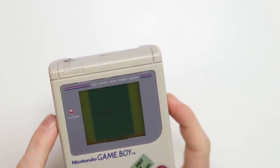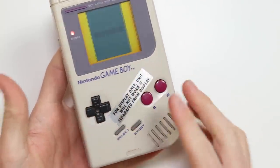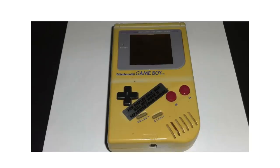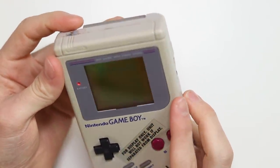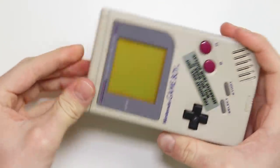One thing that's really nice is the contrast and the volume wheel is very, very stiff. What that means is the potentiometer has not been moved a lot, which is a good sign that it's actually quite a good condition, unused Game Boy — which is really, really cool. You do see some of these with a bar across it, and if the Game Boy's gone yellow it's going to leave a white line across there. It is not working with the game right now, but it should be — I think it's just because everything needs a good clean.